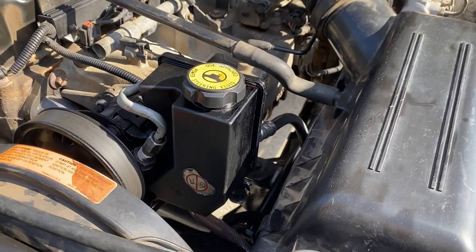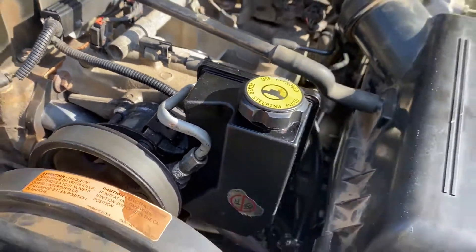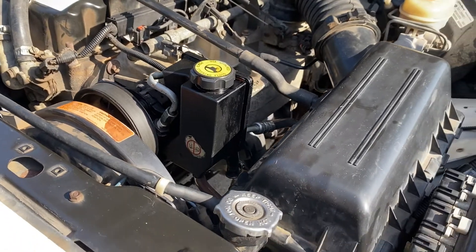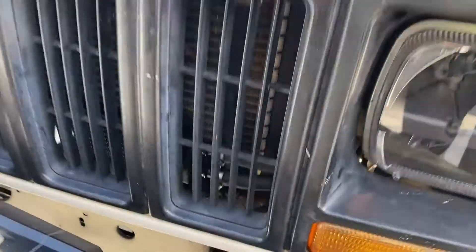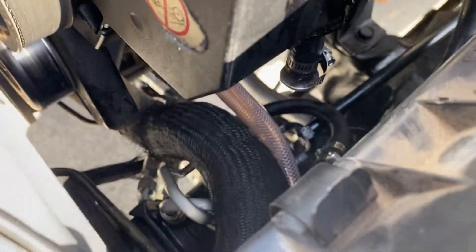In the end I used yellow thread tape, which worked great under the hood. Not much has changed really — it's a WJ pump, which is a super easy upgrade to get more flow. I'm also running a power steering cooler, which was about $20 off Amazon. That's pretty much the majority of what you have to do to have hydro assist.